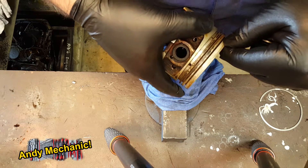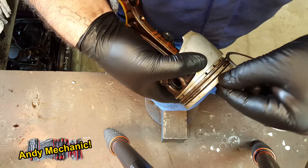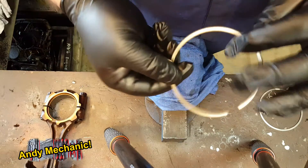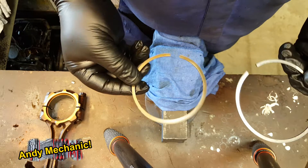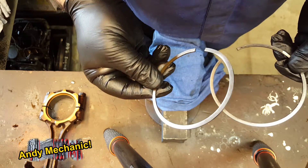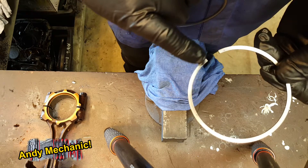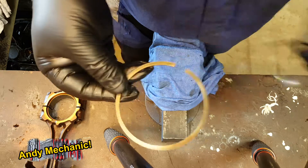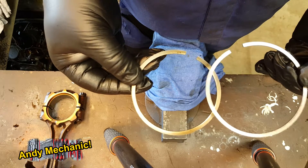We've been measuring the side clearance on the previous video, so obviously you don't measure side clearance on the oil ring. So there we go — two piston rings, number one and number two. They are different, so don't mix them up. You'll notice some lettering; the lettering indicates the up position. So this will be up on the piston. Those numbers also denote which is which, if you know what each one means.